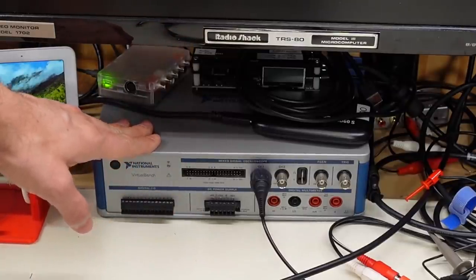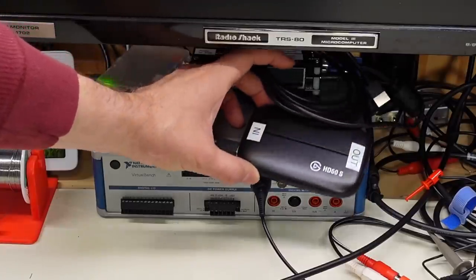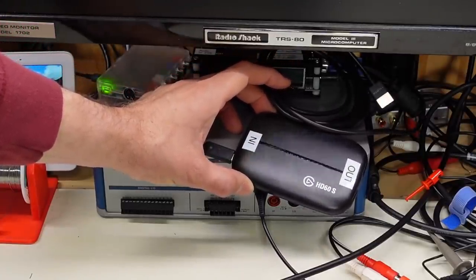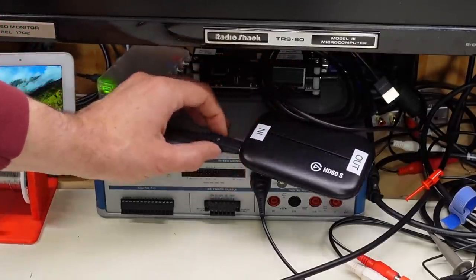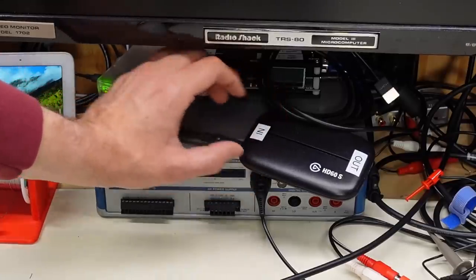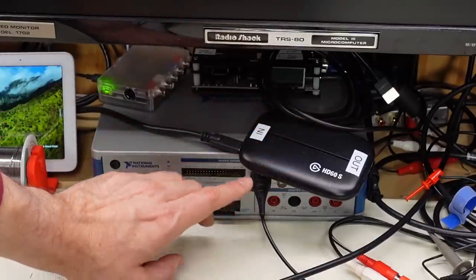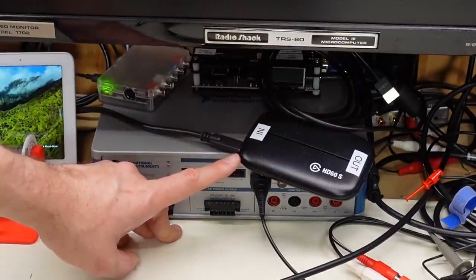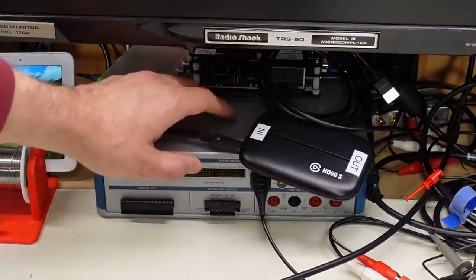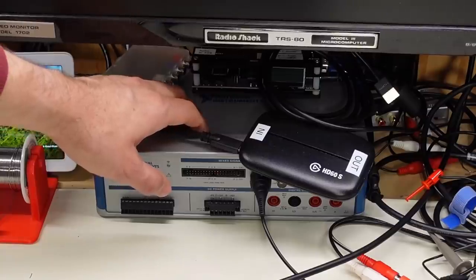This is pretty capable. It's plugged into my bench PC, which I'm going to talk about in a second. On top of that is my Elgato HD60S, which is an HDMI capture device. It's got in and out, and it's USB-C 3.0 SuperSpeed connection to the computer. This sends a raw 1080p image up to that data stream at 60 frames per second to the PC, which has to do the encoding using a video card capable of that.